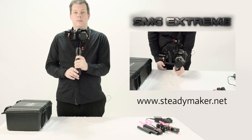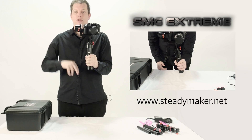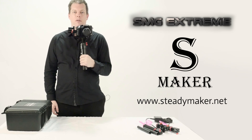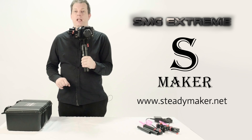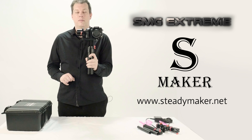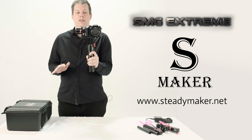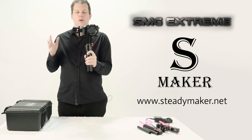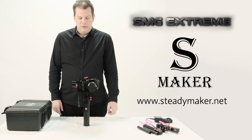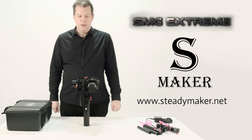If you press the silver button three times, you'll hear a series of tones and now the camera is locked in both pitch and yaw — meaning if you move the handle left and right it will keep the stabilizer straight and level wherever you point it. Three short presses locks the stabilizer in a straight and level perspective. If you press the silver button five times very quickly, you'll hear a series of short tones — this is a quick calibration mode that readjusts and rebalances your motors in all three axes. Keep it steady while it finds balance; once it stops beeping it returns to your control.